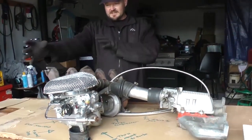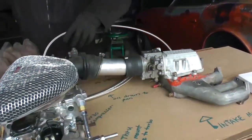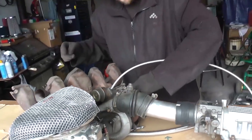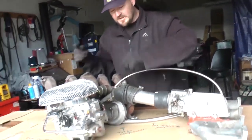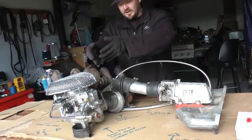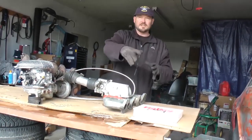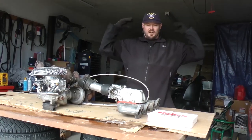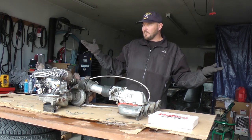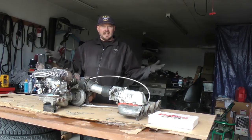On this table I also have the exhaust manifold. Imagine the heads right here shoving your exhaust into the exhaust manifold, driving the turbocharger. A shaft goes between the exhaust section of the turbo to the compressor — basically it's an exhaust-driven supercharger. The exhaust-driven turbine via the shaft drives the compressor, which sucks the fuel-air mixture from the carburetor, compresses it, shoves it into the intake, and raises your effective compression. It can turn your compression from around 8.5:1 or 9:1 to about 15:1 or more depending on your boost settings.